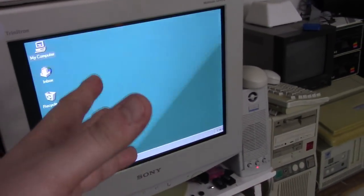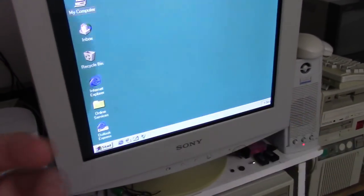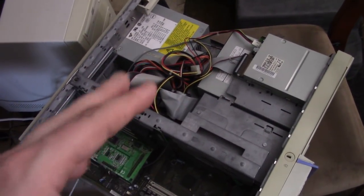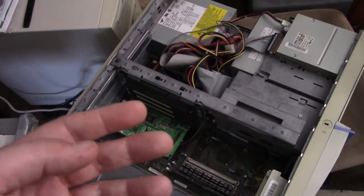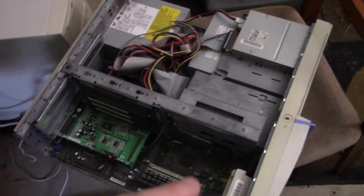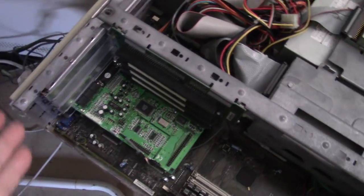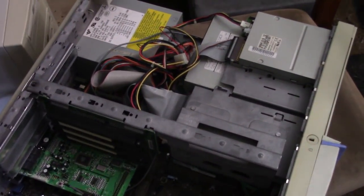Now, I'm not saying the Cyrix 5x86 PR166 Plus is incompatible with Windows. But I am saying, with my particular setup and machine, or motherboard, or whatever, it was preventing Windows from loading. It would freeze consistently, 95 and 98 SE, at the splash screen. I think I tried installing Windows 95 twice and 98 SE three times, maybe even four times. Same place, it would freeze up completely. And I tried many configurations, including the one that worked right now, which is just the sound card, and I'm just running off the built-in Trio video chipset.